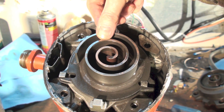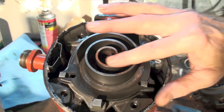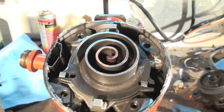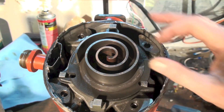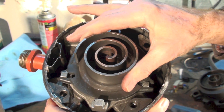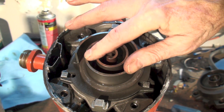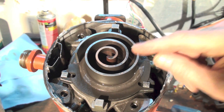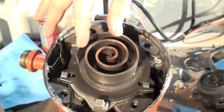You can tell it really doesn't have to go very far. The top scroll fits onto this one — we've only got a little less than half an inch there. With the eighth of an inch for the top scroll that has to fit inside, you've only got maybe three-eighths of an inch left. As this thing oscillates back and forth, it tends to close up and trap gas between the two scrolls.